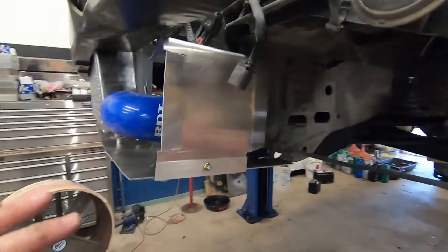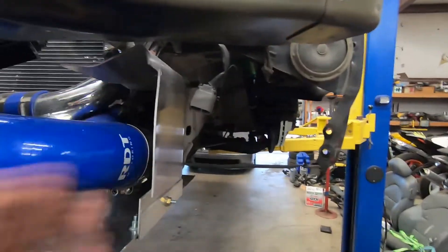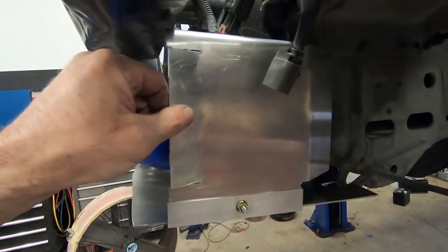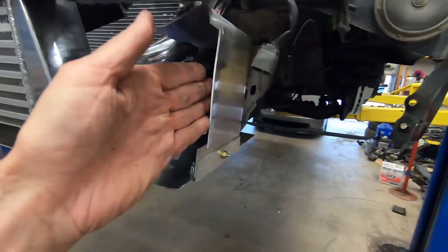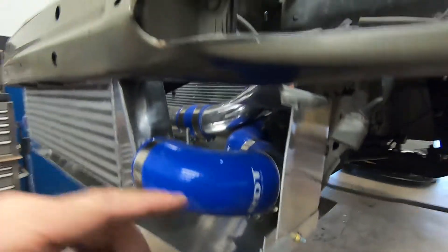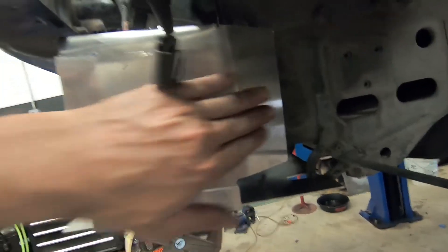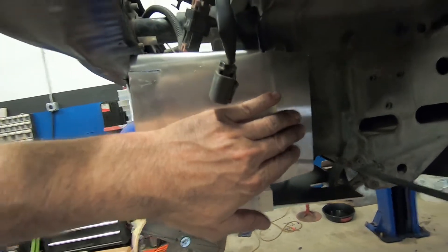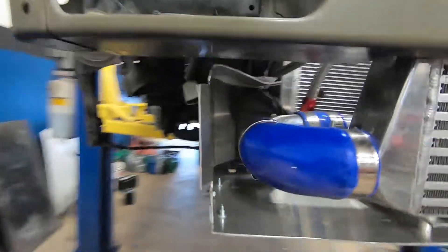I'm really digging the air ducting on this car. It took me quite a while to figure out how to get the proper bends and make the side ducting correct and get it to look really nice and functional. What I ended up doing was coming up with a relief cut right here and a slight bend outward to make room for the side ducting that's on the factory bumper, because it did interfere right here. I also had to do a relief cut right here in order to utilize the mount that's on the bumper shock.